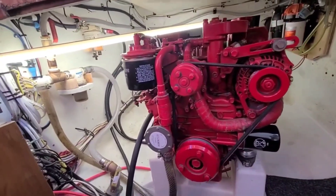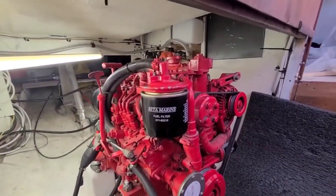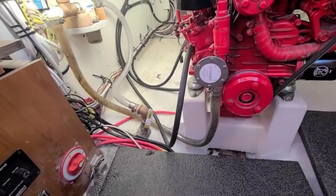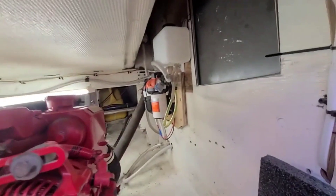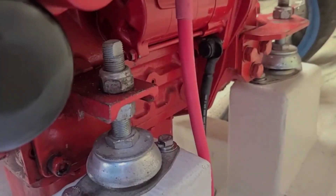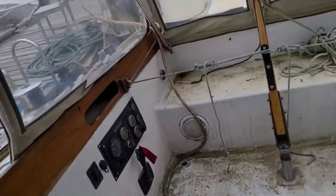Anyway, the fuel line is primed. The fuel goes up to the fuel filter and everything looks ready to launch. As I connected the cooling hose, I can actually use the outboard pump to have outboard water on the vessel. Another day — I have connected the minus wire to the terminal right there, and water and fuel are open. Let's run it!